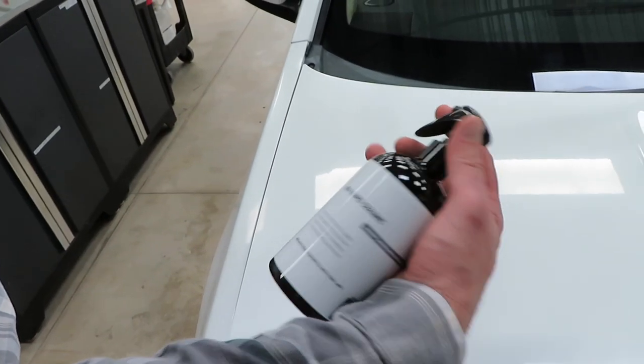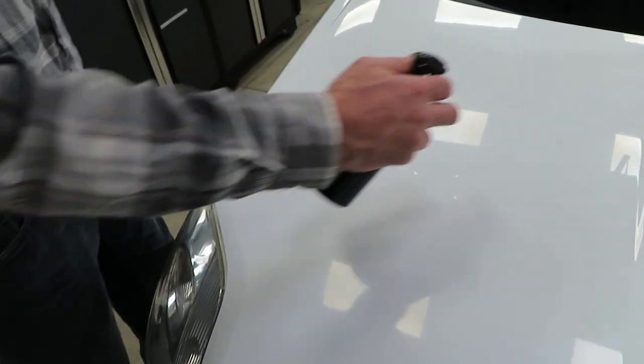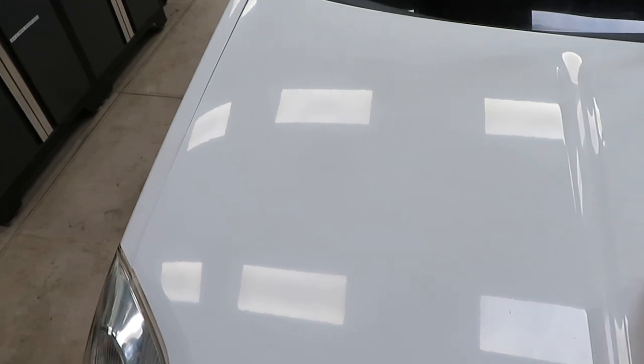Now I'm going to hit it with our rapid ceramic on this side, which has not been prepared — it's only been washed. Unlike the rest of our coatings, this coating is water-based, so it's fine to go over water if you have a little water on your paint after you've come through the car wash. You can see it starting to haze out a little bit — it's not going to rainbow like your other coatings do, and there's no cure time required. So we jump right back in after we've wiped it on and keep polishing it until it goes nice and shiny. Quick and really easy. You can run your hand across it — this section is not coated and you can definitely feel the difference in smoothness.